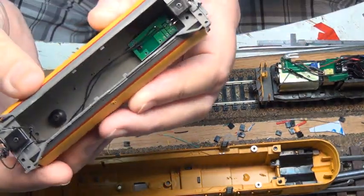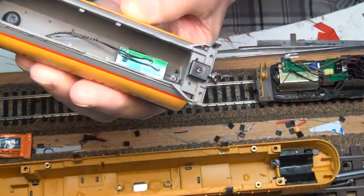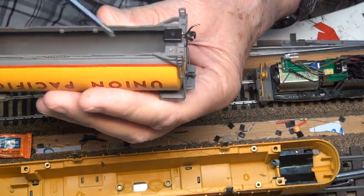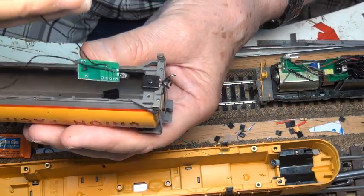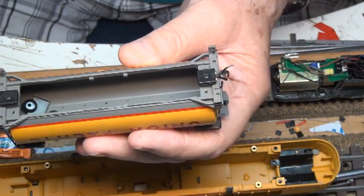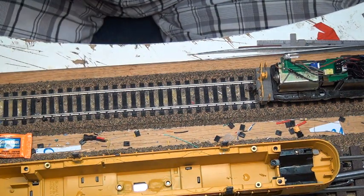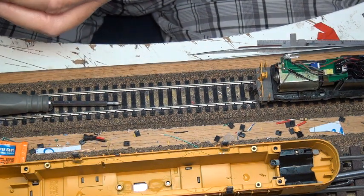And then you can see the light assembly in the back here, I'm pretty sure. Move the light over a little bit more so it gets more into it. So there's the light assembly. It has one screw that holds it, and it has a standoff that you can see in there. Once you've got that out, you can put this aside carefully. I don't want to lose this screw. However, I do have an extra.